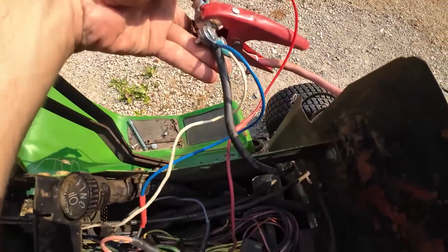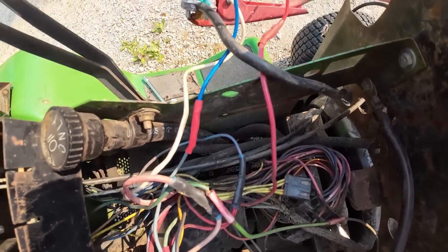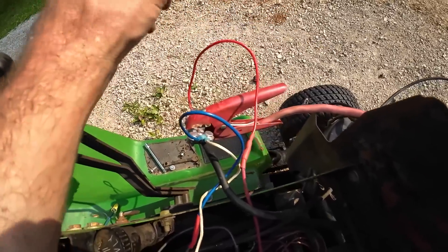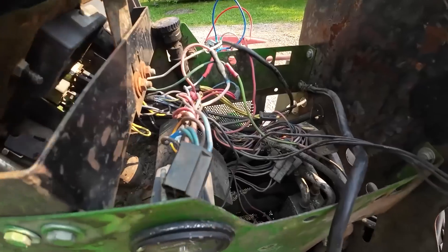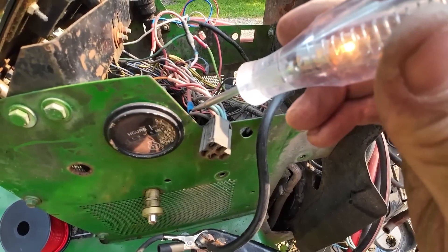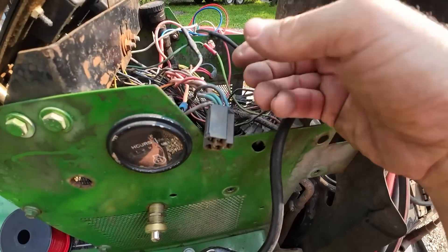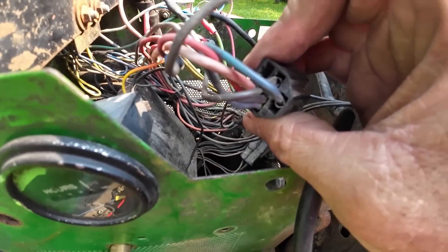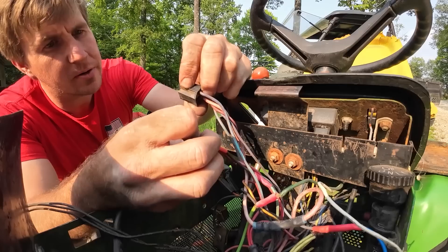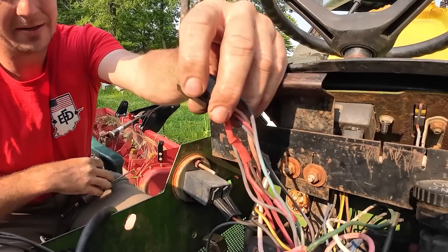I got this cleaned up a little bit - I put a whole new battery terminal on there. It was a blue wire so I'll just add another blue wire, put new ends on everything, heat shrink connectors. Not saying it's not a hack job but it's like a professional hack job. The good news - here's where the red wire comes down, I'm trying to get out of the back side of this connector. I was getting nothing on this, gave that a pull and there's nothing there anymore - so I've got to dig that connector out.